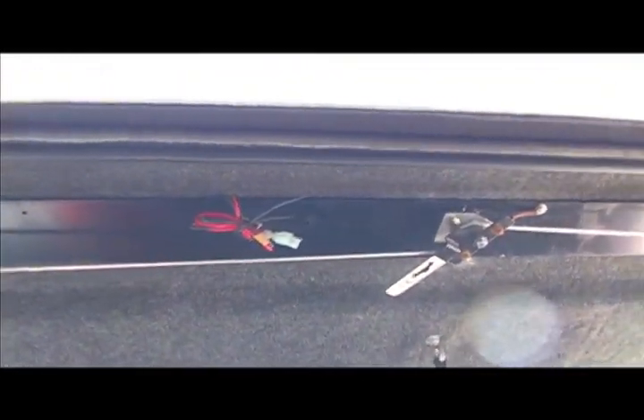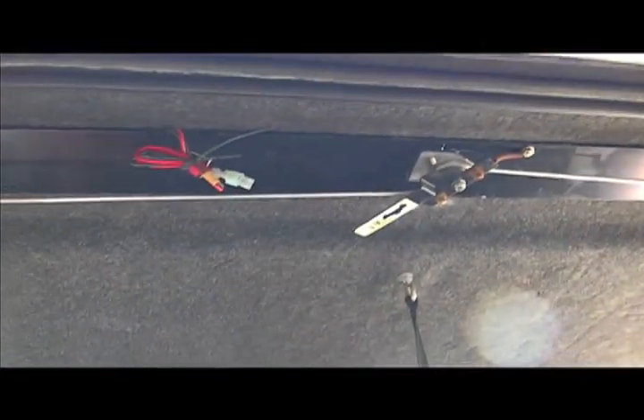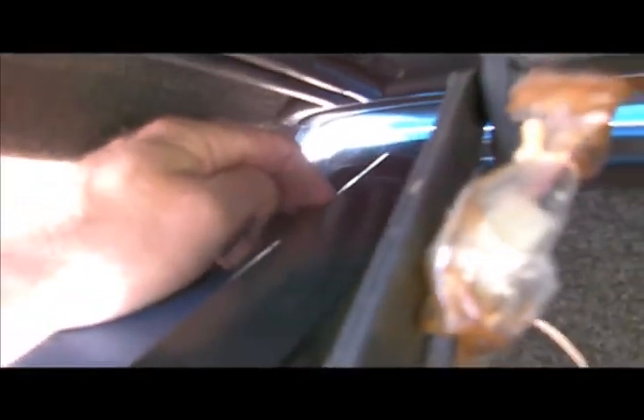Let's talk a little bit about wiring. This tonneau cover is pre-wired, but the back end is not connected to any light source — it has no brake lamp; it's just something done during manufacturing. The other end of the harness has already been run back to the corner near the hinge. What I've done is drop a wire through the wall of the bed — I ran it right underneath the top lip into the tent stake hole and then down the outside body panel — so the wiring does not go inside the truck bed at all. That way we don't have to worry about any breakage. It runs straight down between the walls of the truck bed.